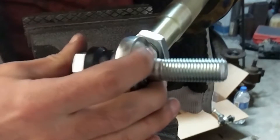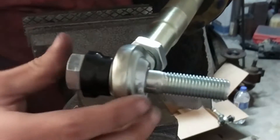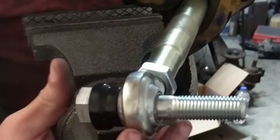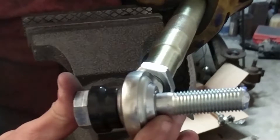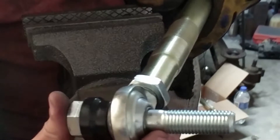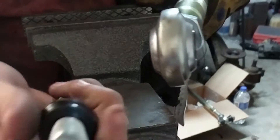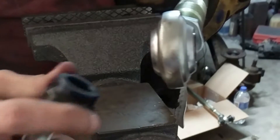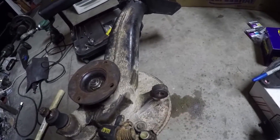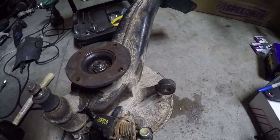It'll allow for a decent amount of rotation, it's not going to clash early or anything, but hopefully it'll dampen a little bit of the noise so we don't have extreme noise in the cabin. Most of these heim joints are known to be louder just because of metal-on-metal connections. I might later on inject some urethane where I can, but for right now this is the only urethane I have and it's pretty hard — probably in the 85 durometer range rather than the 60 that I normally use.